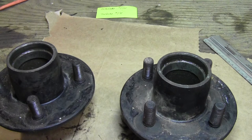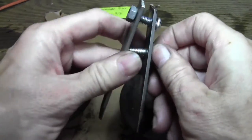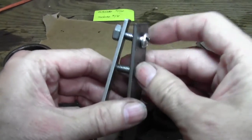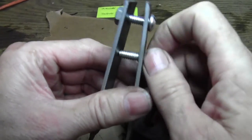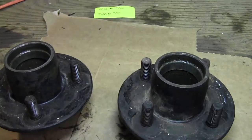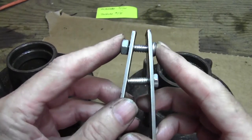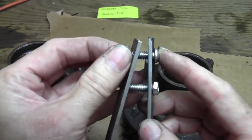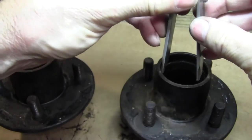So I was thinking: how can I remove these races using my Harbor Freight shop press? I came up with a quick little way to do it that worked really well, and that's what I'm going to share with you today. Here is the little tool I made — it basically equals two drifts. I've got a threaded bolt here — this wouldn't have to be threaded; if you can't do threads you could put a nut on the inside. It's a three-quarter inch bolt, and then this is a bolt that I cut specifically for this.